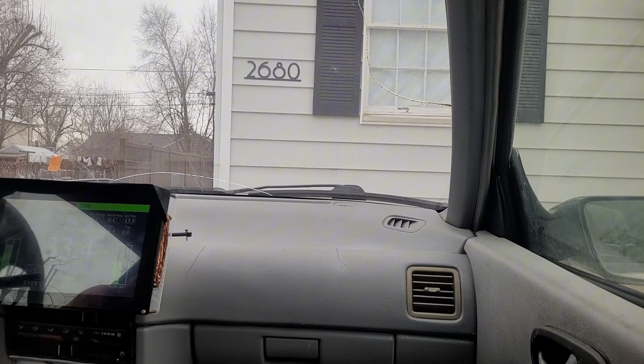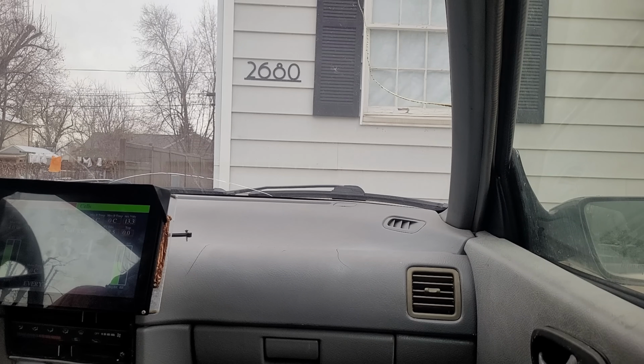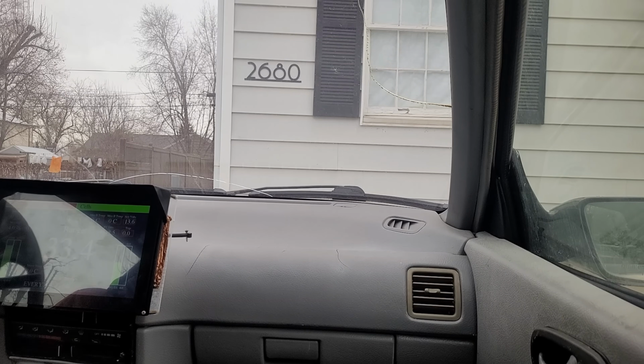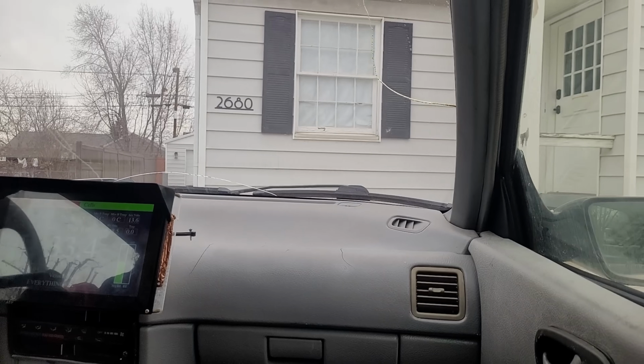Alright, it's super cold out, so my range is pretty low, down to 4.5, so it's got about 35 miles of range. That sound you hear there is the brake vacuum pump setting up. Now the brakes are pressurized, and it won't turn on again until I lose some of that pressure after braking a few times. But the part that blows everyone's mind is there's no engine idling, so I don't need to clutch to start from a stop. The motor only spins when I hit the gas. So I'm in neutral now, go to reverse, and just hit the gas, and I'm moving. It's dead silent.